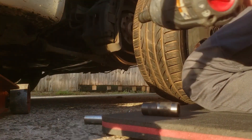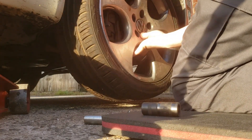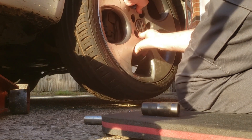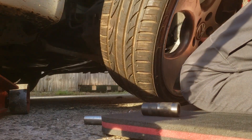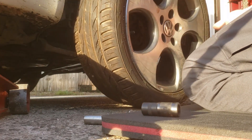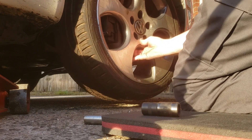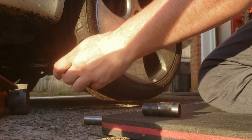I'm hoping the hub center is the same on these. I think Volkswagen and Audi are the same, but I'm not sure actually. Looks like they're not — oh, never mind. It's got hub centric rings on it. Take those off and see how it fits now. Oh, perfect — like a glove. Let's get this wheel locked back on.